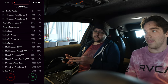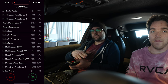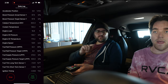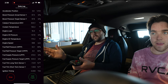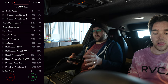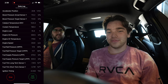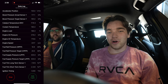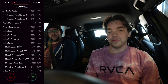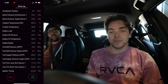There are two types of logs I'll ask everyone for. The first is a third-gear wide-open-throttle pull: start the pull at 2,000 RPM, go wide open throttle, and accelerate all the way to redline in third gear. The second is a 10-minute general driving log — just drive around for 10 minutes of stop-and-go and highway cruising so I can see how you use the car, identify anything unusual in the areas of the map you'll actually run in, and customize the tune accordingly. We took a log off the car and did three or four pulls.